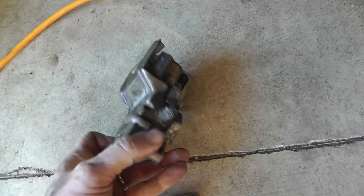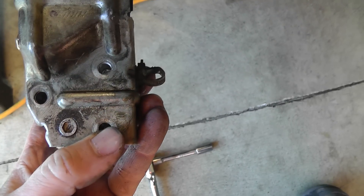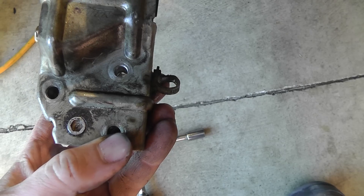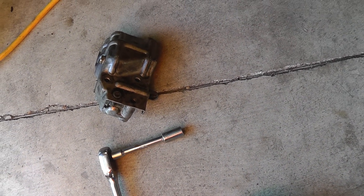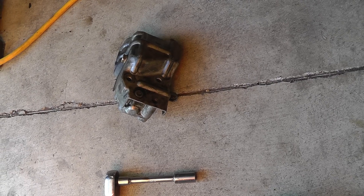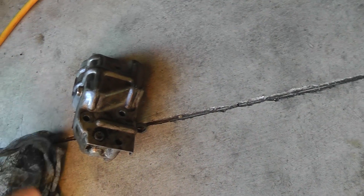Now, the nuts on the back are torqued. There are three bolts — only three. Don't worry about the hex nut, just the three bolts, and then it'll pry off with a screwdriver up top — pry it off very carefully. They are all torqued at 7.2 foot-pounds. I didn't torque them with my torque wrench because I was a little afraid about over-torquing. I hand-tightened them, then used the ratchet to torque them down a little bit, then went maybe another quarter turn. That seemed sufficient — if you over-torque it, you can have problems. Doing it the old-school way was better for me.